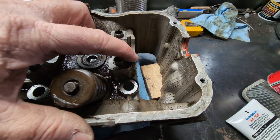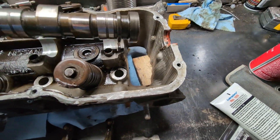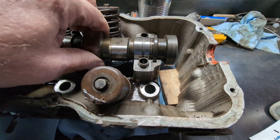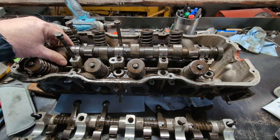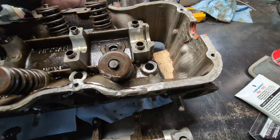This is cracked, and that's actually where the camshaft sits in. It's got a ring around the camshaft that locates it front and back. Most likely what somebody did is when they were taking this out, they grabbed the back and pried it up and cracked that. So that's a write-off.